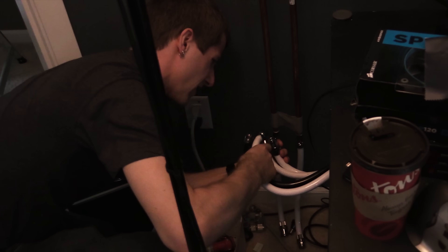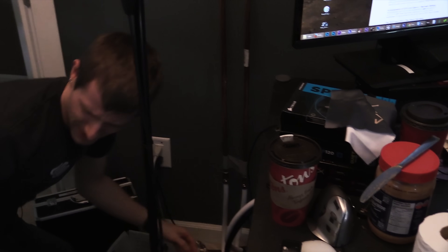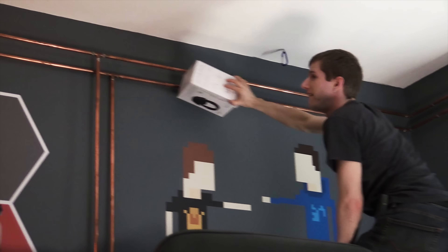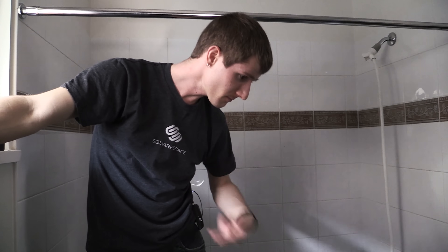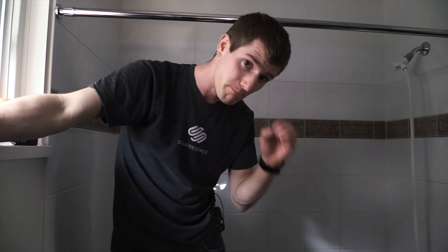We need to get everyone but Burkle's system off the whole room loop. You just put mine on the loop and now you're putting it off. Well, it's a diagnostic process. Why not mine again? Because we want all the pressure going to your loop to force bubbles out of it — because you're at the very end, so you kind of got the ditch loop spot. I'm trying to loosen bubbles, I'm not going to tip it. If I get hit in the head with a hard drive, I'll be upset. Not as upset as the hard drive. You shouldn't drop hard drives like that. Said the guy who tipped the system and dropped the hard drive before. The bad news is that two pumps is still not enough to bleed all the systems at once, but is definitely enough to properly bleed one system at once. When before with only one pump it was like barely enough.